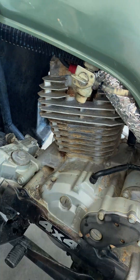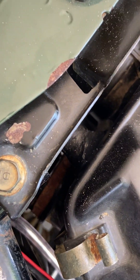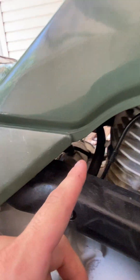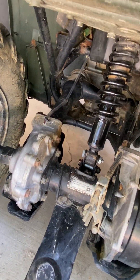Let me show y'all how to do the crank. So the crank hose — this is the crank right here. What I did was I bought some 5/8" heater hose, ran it — you can see it right there — it runs right there and then I loop it and go into the air box. I drilled a hole a little bit smaller than 5/8", gotta work it in there, then silicone it, let it sit overnight and she's ready.